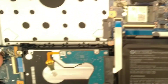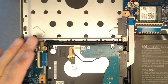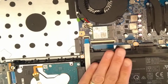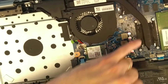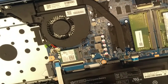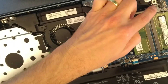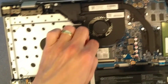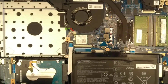So, what's inside this computer? We've got the standard serial ATA hard disk here, a wireless card is here, the battery which is non-user replaceable unless you do what I've done to take it all to bits, RAM there and there, and a CPU with a cooler. The CPU is BGA array soldered onto the board so you wouldn't be able to change that processor out yourself. Probably the video connector there, and the power socket is over here — the power socket connector is this white connector here. That's probably the speaker there.